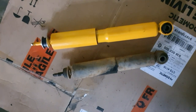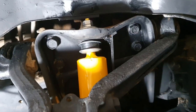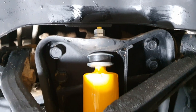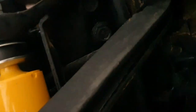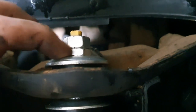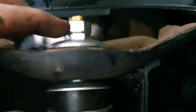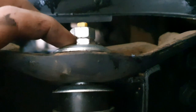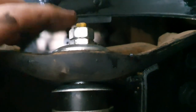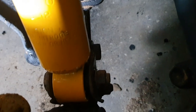Here's the difference between the old and the new one, and here's the new one in place. I'm going to put back the bolt down here and then the two nuts at the top and we should be done. A quick note: with the lower nut you don't want to go crazy tightening it down because it will run out of thread — that's when you stop, put the next one on, hold the lower one with a 19mm spanner, and then torque the top one down with a socket. The lower one goes back the same way it came off.